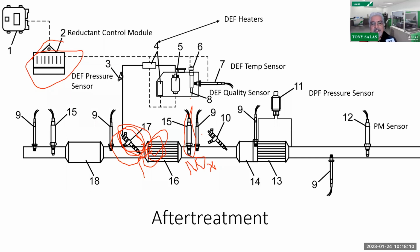So what is the cause of this? The cause is that this truck does a lot of idle time, a lot of slow time, meaning it's not loaded very much and doesn't ever get warmed up. Is it possible that we could be loading up with ammonia? Yeah. That's why, as a sidebar, the Ram Dodge has an ammonia slip catalyst. General Motors doesn't use one. On a Ram Cummins, they do have a catalyst to absorb that excess ammonia. At the tail end of it, there is an ammonia slip catalyst and also an ammonia sensor. But General Motors doesn't use this on the L5P. Now, I haven't checked 2023 models. I'll be honest with you, I haven't looked at a brand new truck. But I know that the 21 and 22 models do not have it. So there you go.